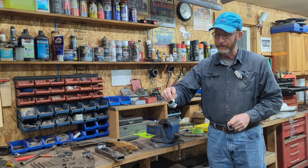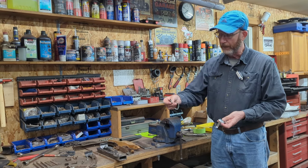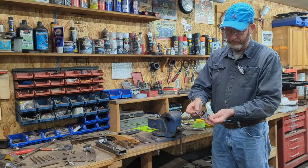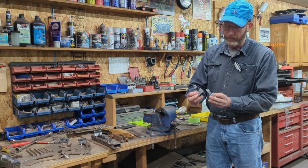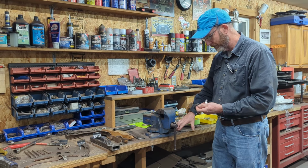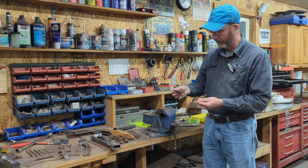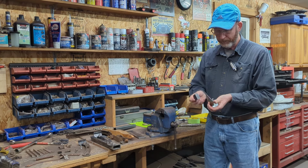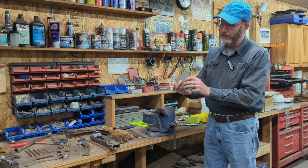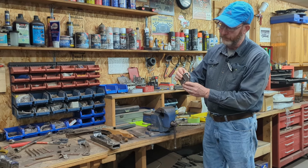This is the Vintique one right here. Here is the one that I made. So just measured where the bends were, stuck it in the vise again, bent it over. In some cases, the bends were in excess of 90 degrees. So what I then did, I took a piece of thicker 3/16 plate that's got a 45-degree chamfer onto it.